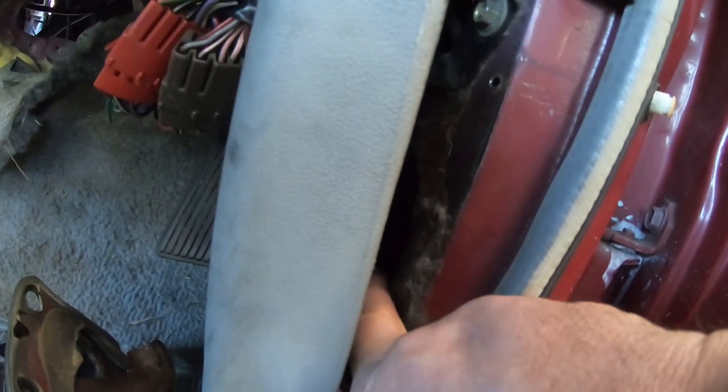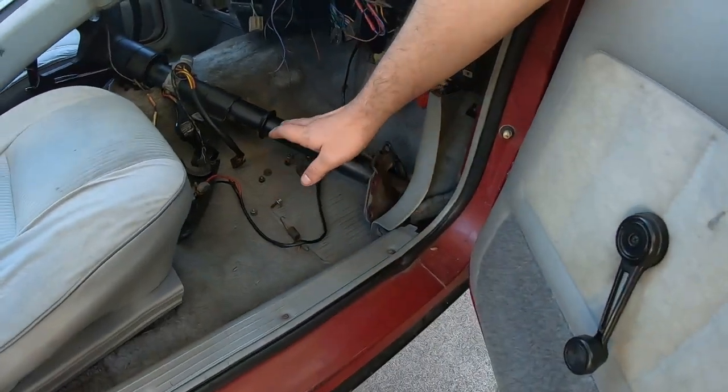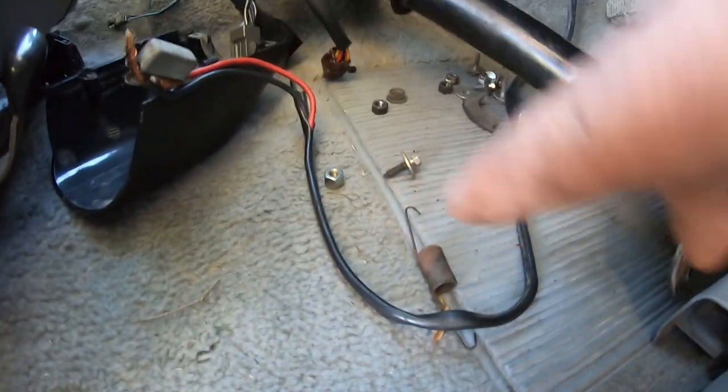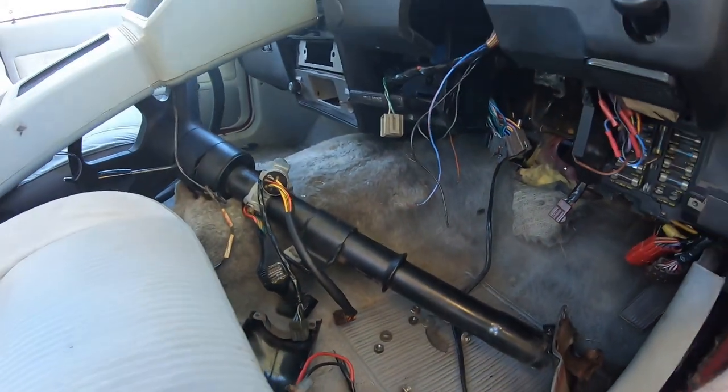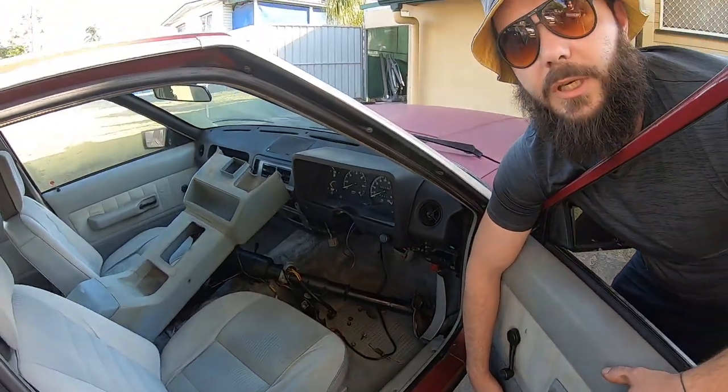If you're lucky, you can potentially pull up the carpet and check the floor panel. Through that hole you can see what's going on from the plenum. Generally you'll get an indication from the carpet — if it looks like it's been wet and dried quite a bit, you'll want to look underneath. This carpet is remarkable; this guy picked a great example to show you.